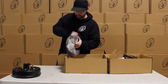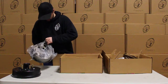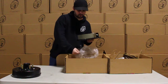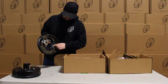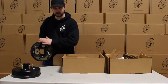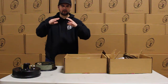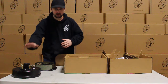Here's our auto adjust brake. These are TruRide brakes and TruRide hub and drums. They do come with the magnets already installed. You can see this cord — this is our auto adjust cord right here. It's going to be a big difference between this and the other ones. What this allows us to do is, as you drive, the brake pads will automatically self adjust out so that they stay the same distance away from the hub and drum wall.